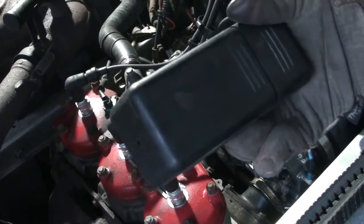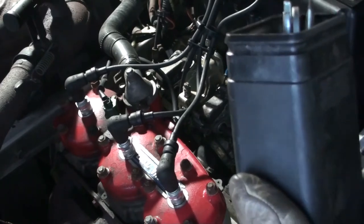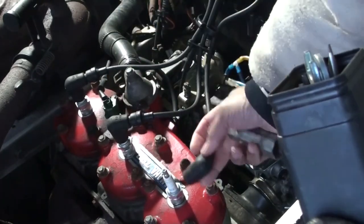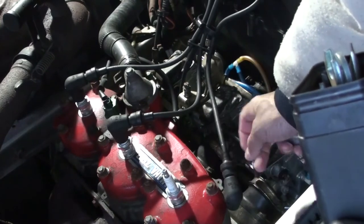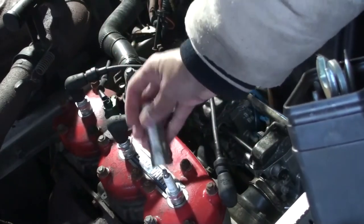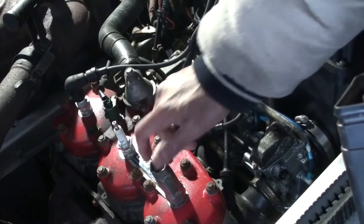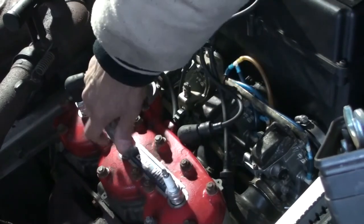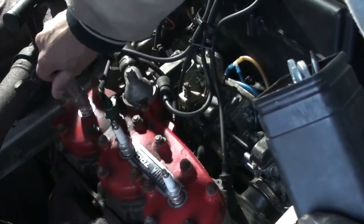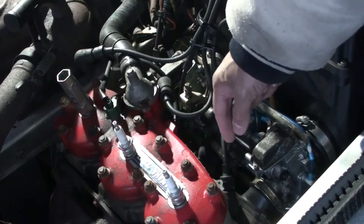There's a little toolbox that comes with every snowmobile. I take out the spark plug wrench and make sure it fits the spark plugs. When you pull the spark plug cables off, keep track of their positions — this one goes to the left, this one to the middle, and this one to the right. Make sure you don't get them mixed up or the firing order will change. I kept them loose when I put it in storage, so they should be hand-removable. Avoid placing your tools near the engine because if something falls in between, you're never going to find it.